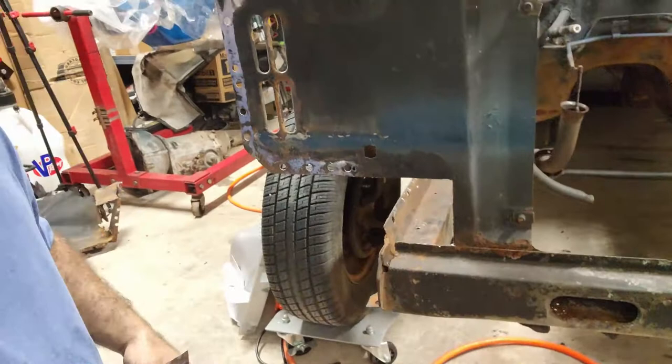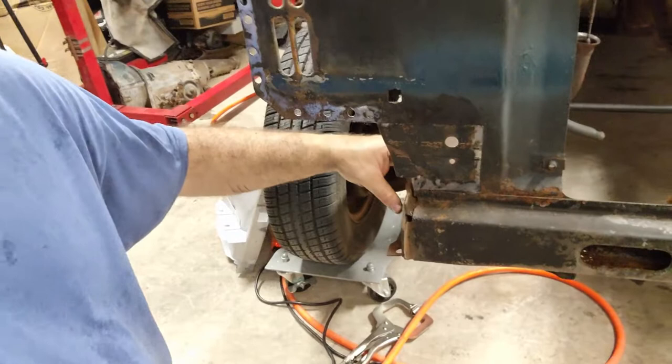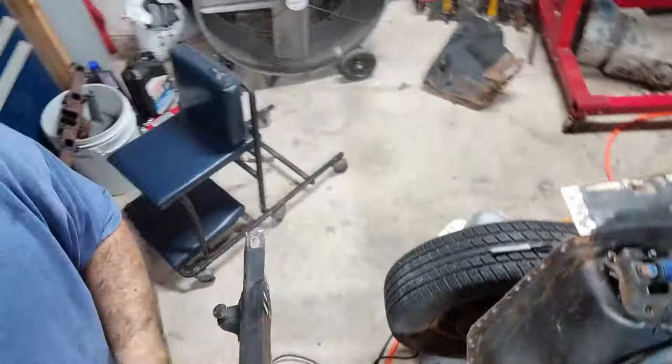I created my patch panel because this area was pretty rusted out right here in this spot, and so what I wanted to do was bring this in and recreate that. Not concourse correct, but pretty much does what I need it to, and I even made the match of that angle across it, so that takes care of it. Then on the inside, you can see here I cut down to the core support, to the frame rail on the side, and then the frame rail on the top, to provide that extra support, because all of that is not great right there in the corner.